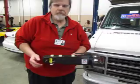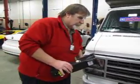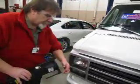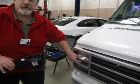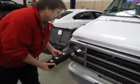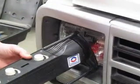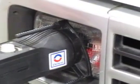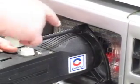Everything's set at 0. I'm now ready to go ahead and attach my aimer to my headlamp. What I like to do is set the pads on my adapter on the bottom 2 pins that are on the headlight. So I now have the 2 of them sitting on there, and I'm going to bring this up, so I bring the top rod onto the top pad.